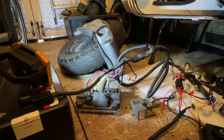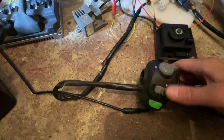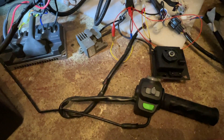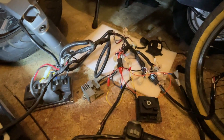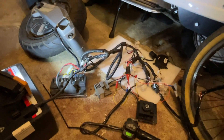Now the trick will be to figure out how to integrate this all into the Vespa. For the most part I'll be using all this wiring and integrating the headlights, taillights, and turn signals — any other display lights on the instrument cluster — and figuring out how to mount the grip with the speed controller. I'll probably keep this as it is. This is the kill switch as well — or rather not exactly a kill switch, but it turns off essentially the brake so I can actually run it. I have bypassed the alarm module and the ignition module because I don't have those — someone bought those from me. But otherwise this is very, very good. I'm very happy that this all works, and I can move on to the next step.